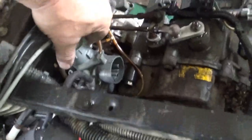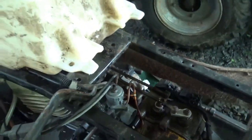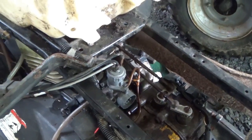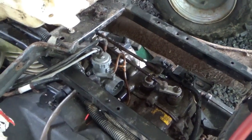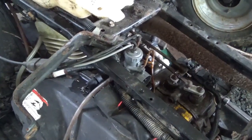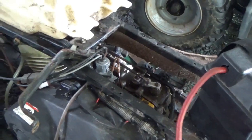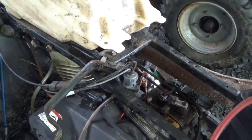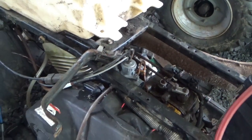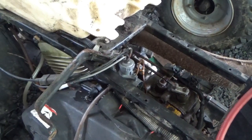This carburetor is truly gummed up to beat the band. I'm gonna see if I can't put my hot little hands on another one, perhaps an eBay carburetor. Also, as I'm kind of messing with this, hopefully my buddy Kevin is watching some of this and he could give me some two-cycle advice. And then get the gas tank off, wash it out, stuff like that. I'm probably gonna initially fire this up. The gasoline I'm gonna use will be that 50-to-1. If the oil pump is working fine, it'll have way too much oil. If it's not working, at least it'll have that 40 or 50-to-1 in it.